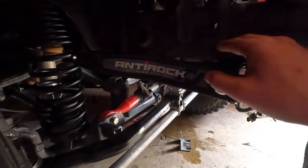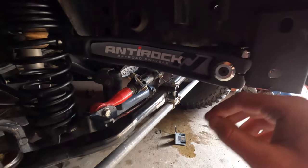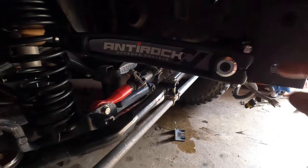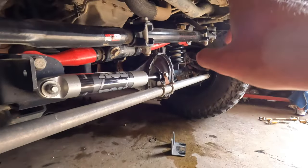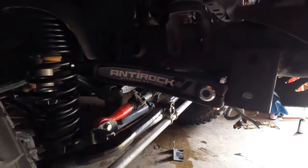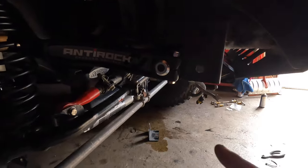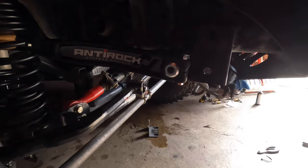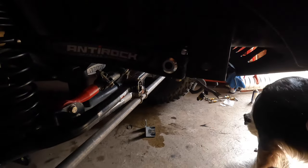For the brackets up here you just reuse your sway bar bolts - I think they're 15s or 16s. Zip them on up there, then you want to install your bushing which you saw me do with the hammer - not too hard to do. Now something that was pretty difficult was putting in the actual torsion bar. What I did is I put it in one side and just started wailing at it. It took about five minutes straight of hammering with a mallet. Make sure you use a mallet - you do not want to damage those threads on the torsion bar. Get yourself a heavy mallet because that was not fun.